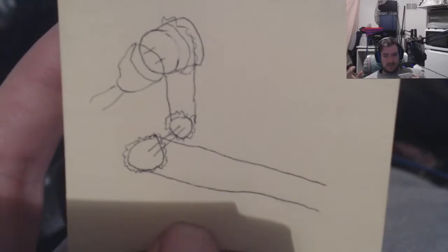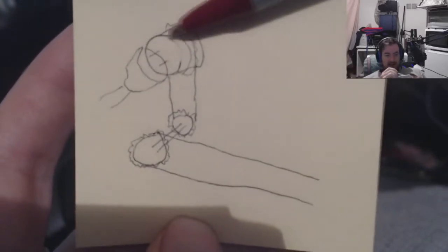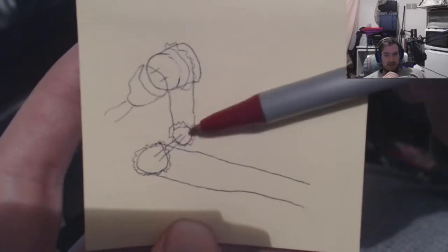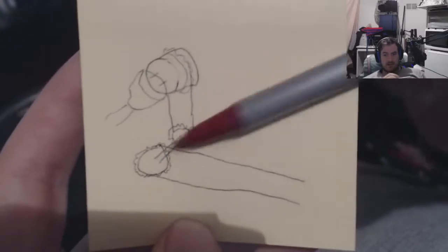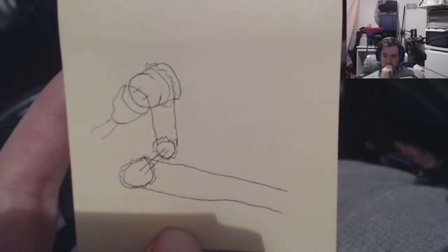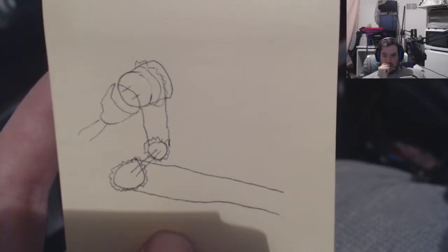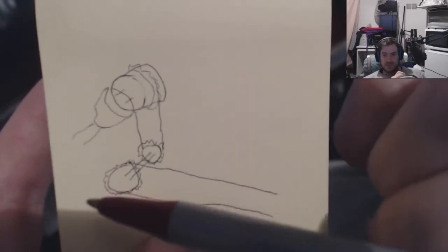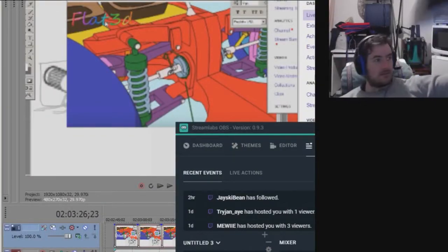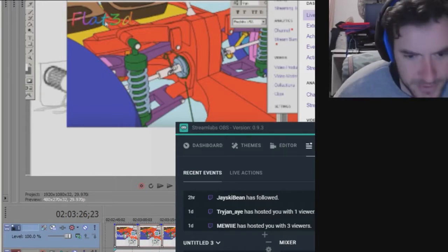So, it may not be specifically like that, but the point is, everything then doesn't have to be in line with this. You have the ability to shift things over by simply having a bar separating two, and then you can move now in the X direction. So we're moving down in Y and X. And then Z would be going toward the rear of the car. But the X direction shift is nice, because you might avoid some critical component that was right here, maybe. So that's just something to bear in mind as a trick to ensure maximum flexibility when establishing a line of sight for the chain to get back to the rear of the car.